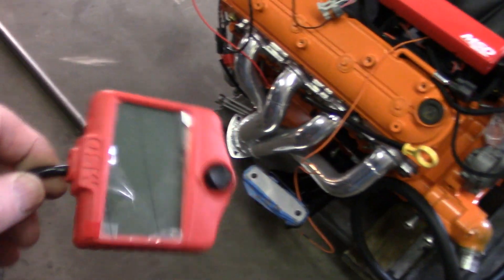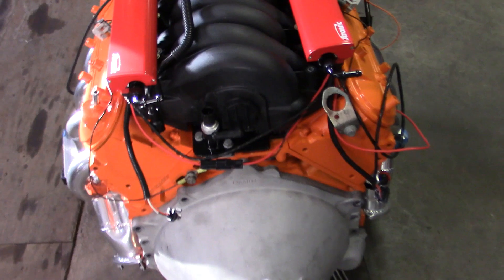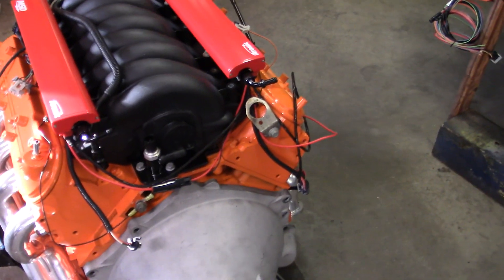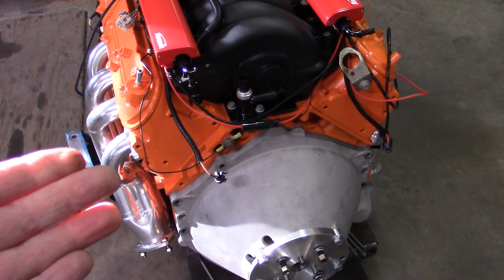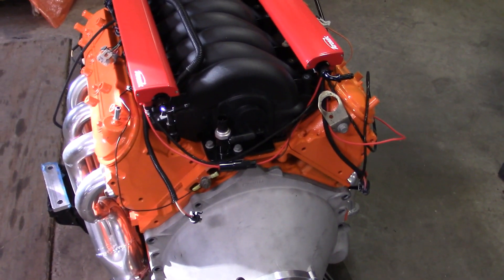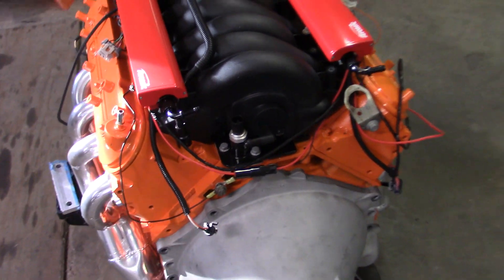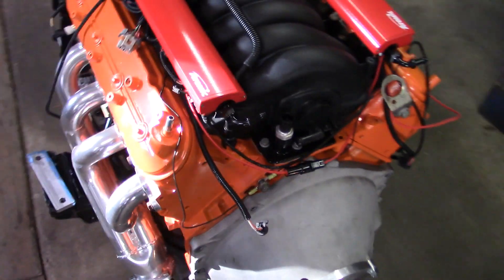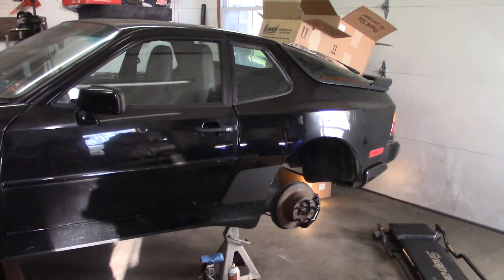What we need to do — we weren't even going to use this — because the Renegade Hybrids kit comes with an adapter that screws into here and goes to eighth-inch national pipe thread, and they give you an oil pressure sender that works with the gauge in the car. So you take this out, put the adapter in, screw the pressure sender into there, and hook the wires up to the gauge. Engine-wise this is all going to work out pretty well. Suspension-wise we've got some work to do.